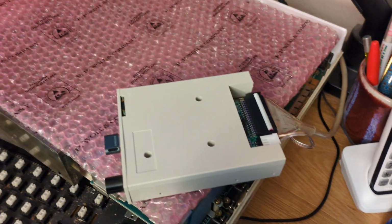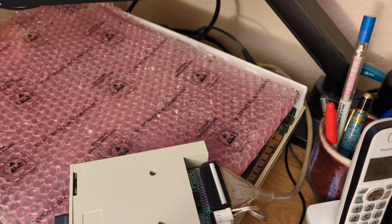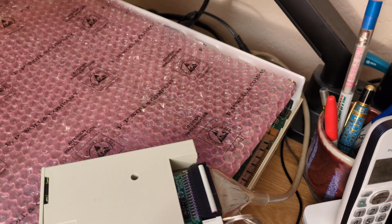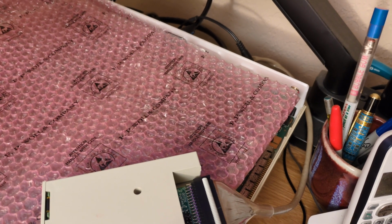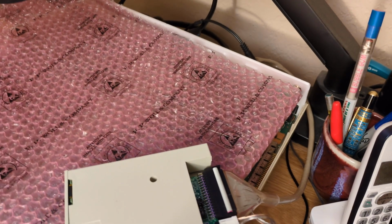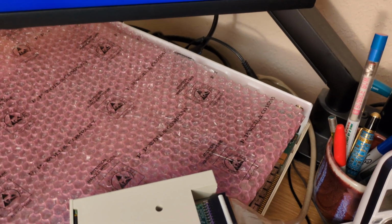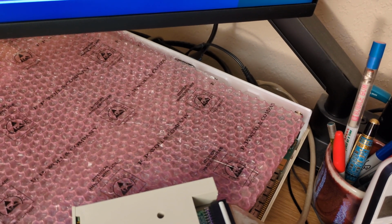But all I did since I first started this and it didn't see the memory, all I did was I exercised the dip switch for auto config, I think, the first dip switch, off and on and off and on a few times. But when I booted up, it still wasn't showing any extra memory. So I don't know what I could have done that suddenly made it work.